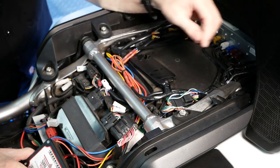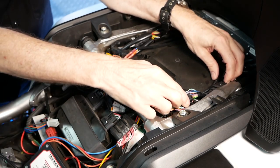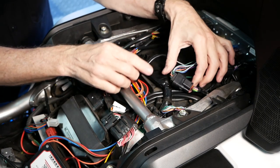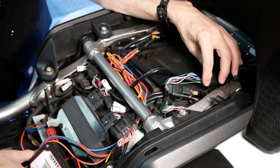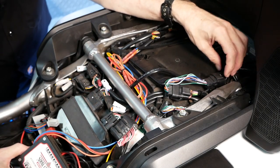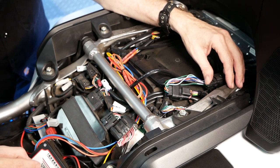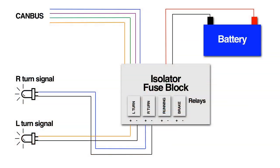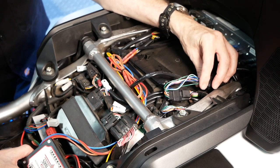The way this works is there is a connector under your seat for this isolator fuse block that connects right into the wiring harness. It has some little wires, taps coming off of it that go to the isolator fuse block, and basically those wires simply operate a relay. This isolator fuse block is connected directly to the battery, so it gets powered directly from the battery for your accessories.